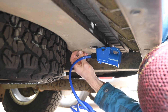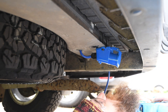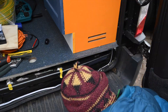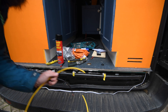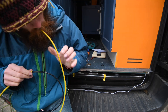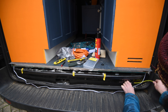Right, next job: sorting out all of this. I think I'll just put a slit in the rubber — there we go, no chafing. Next, I'm going to use another gland just the other way around like that, so we can have the cable coming out of there and running around here up into there. Now I'll leave that to dry for 20 minutes. I'm sure lots of people are going to tell me it's completely unnecessary, but earth cable should be yellow and green. So I bought some sleeving — my earth cable's going to be yellow and green. One earth cable sorted. That's probably going to go into a similar area over here. I'll clear a nice little spot and then it'll be routed inside the vehicle.